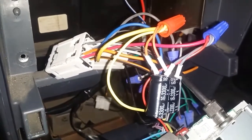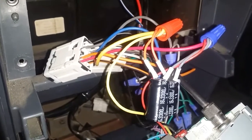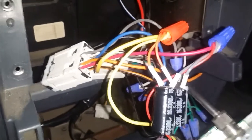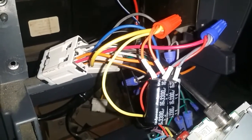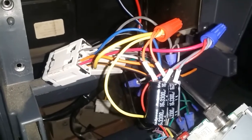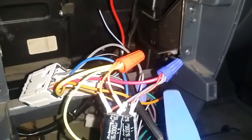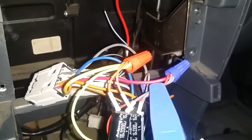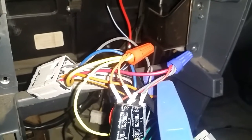The yellow wire is the always-on power that runs to your stereo even when the vehicle is off — you've got 12 volts through there. You might be able to tell that the yellow wire is a little bit thicker, and a little more power goes through there. Then there's the red wire — the accessory wire — which is wired to the ignition.